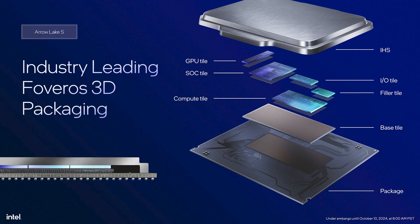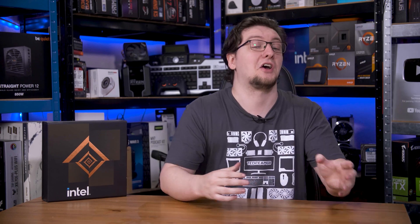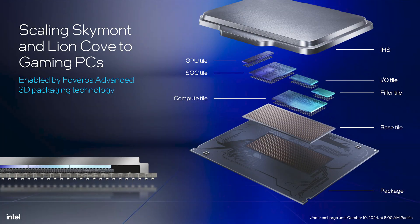The efficiency isn't the only new thing though, and there are some really interesting gems hidden here. The chips themselves use the tiled design that first launched with Meteor Lake last year, but this is the first time we've seen it come to the desktop market. These chips are made up of smaller tiles, similar to AMD's chiplet design — but unlike AMD, they're bonded to a sort of mother tile, the base tile as Intel calls it. The tiles are the compute tile with all your cores and cache, the I/O tile where PCIe connects, the SoC tile where you find the memory controller and NPU, and in this case a GPU tile too.